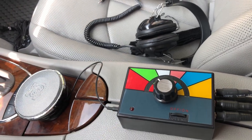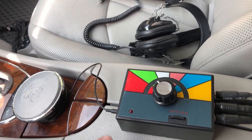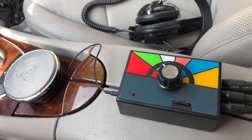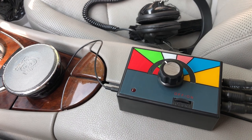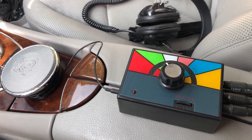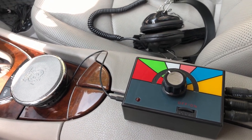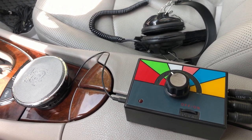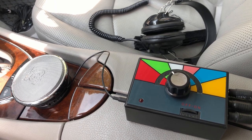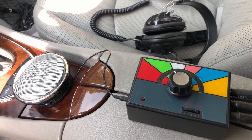I haven't found any noise on the rear wheels, which is a very good sign. However, I did find noise on the differential. One of the things you can do with this tool is turn the volume up and down and literally compare the sounds to the deceleration, so you can tell it's exactly the sound you're picking up. It's very, very clear on this vehicle.